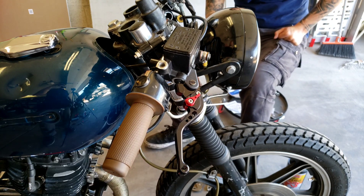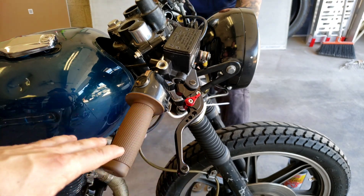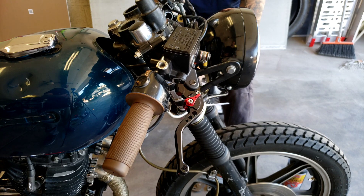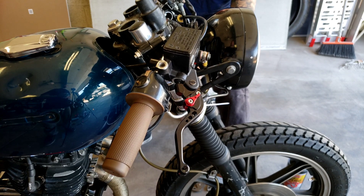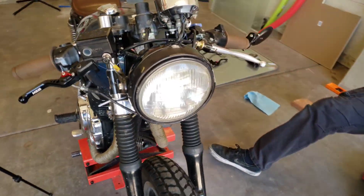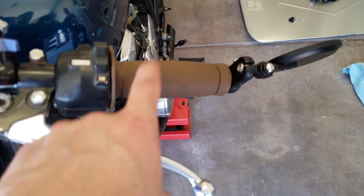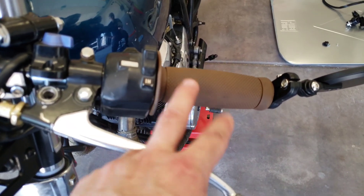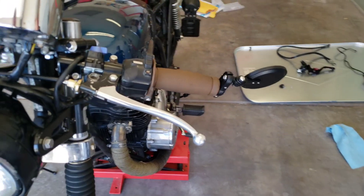We just finished bleeding the system — took roughly 20 minutes, a little longer than expected, because we replaced an entire line and master cylinder so there was nothing but air in the system. When the brake starts engaging it's right here, and there's incredible braking power from this upgraded and modernized master cylinder. The steel braided line and getting practically all the air out really paid off. After he rides it a few times, any remaining air will free up and all he has to do is push the caliper against the disc to force it into the master, then pump it again. Now we're going to loosen these components, slide the bar out so we don't have to take the grip off, slide the new parts on, and install the new clutch perch and shorty lever.